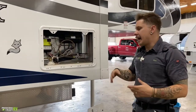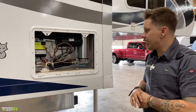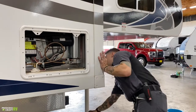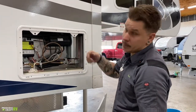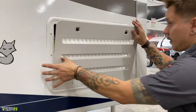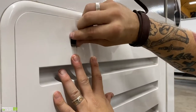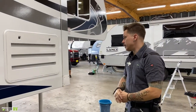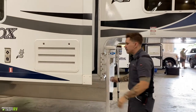Back of your fridge panel here — from a maintenance standpoint, not too terribly much you're going to be doing back here. Give it a visual inspection a couple times a year. Make sure nothing's gotten in, make sure there's no nesting, no frayed wires, and everything looks as it should. This is also going to be an intrusion point for mud daubers and flying insects, so it is important that we screen these vents off. You do have a vent top and bottom. When replacing this vent, put the tabs down first, seat those, then give it an 1/8" turn to the right to lock it on — I always give it a little tug to make sure it is, in fact, locked on.